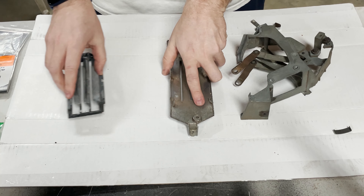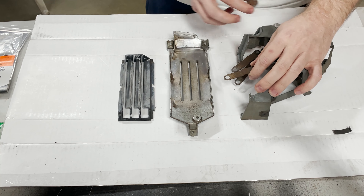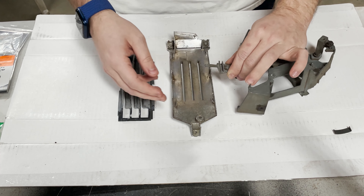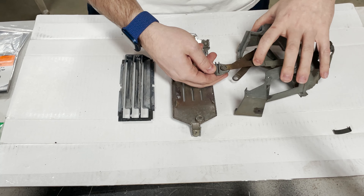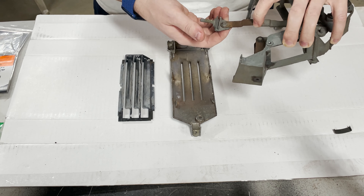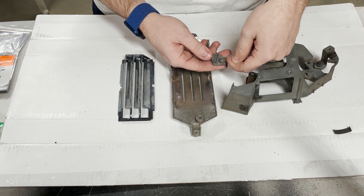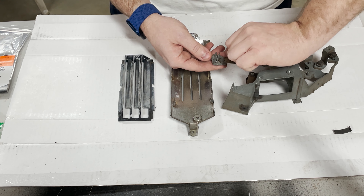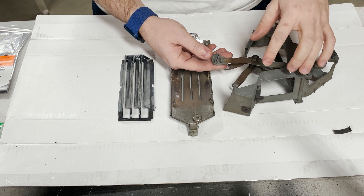Once that comes off you have the main pieces separated, and then the next part is the sliders that will be attached here. Here's one of the old ones — it's basically sitting on here with a little push nut that holds it in place. That push nut is a little finicky to try to get off because they're really stuck on there. I used a flathead screwdriver to get the edges of the push nut up almost all the way around and then needle nose pliers to pry it and pop it off, and once I did that I was able to get all three sliders off.